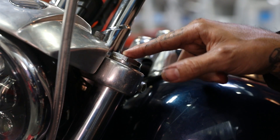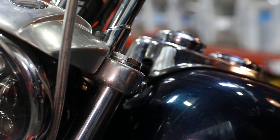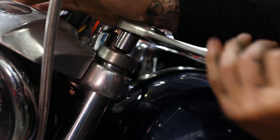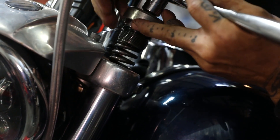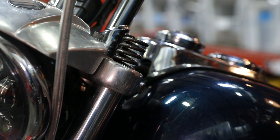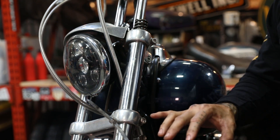We need to remove the fork cap, but don't just break it loose and take it off — there is a spring under here and it is under tension. This thing could shoot across the room, so be very mindful of that. I keep pressure with the palm of my hand pressing down on the ratchet, and it'll just spring up slightly. Once the fork cap is off, loosen the two pinch bolts, remove the tube, and move over to a workbench to finish installing the new parts.